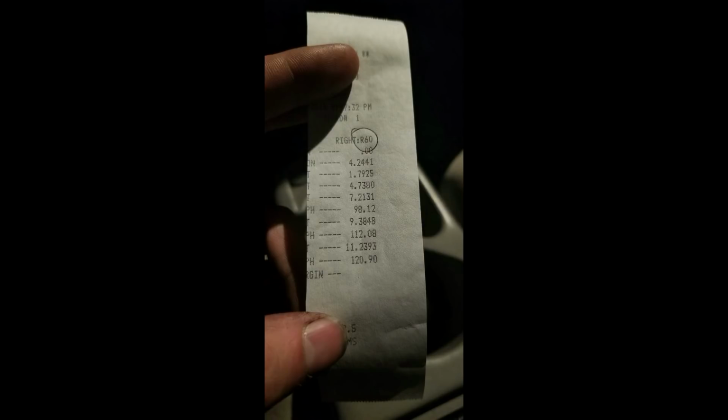After continuing to look into things, I started to log the torque converter slip. If you're not new, you know this. I realized the torque converter was slipping almost 30% during the pass, 20 to 30% in third gear. So I feel like the engine was making the power, but no matter what I did, it wasn't gaining miles an hour. It was a consistent 22 miles an hour on the back half, no matter what I did.